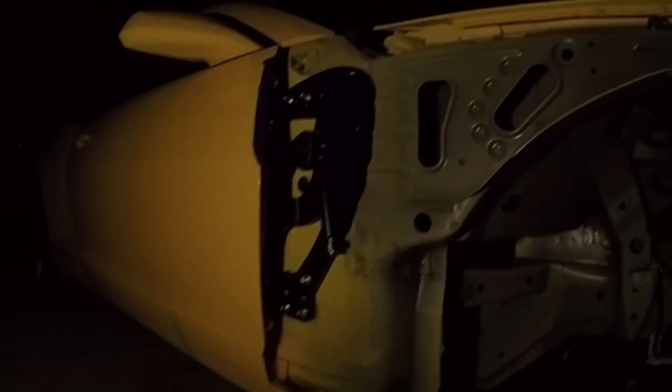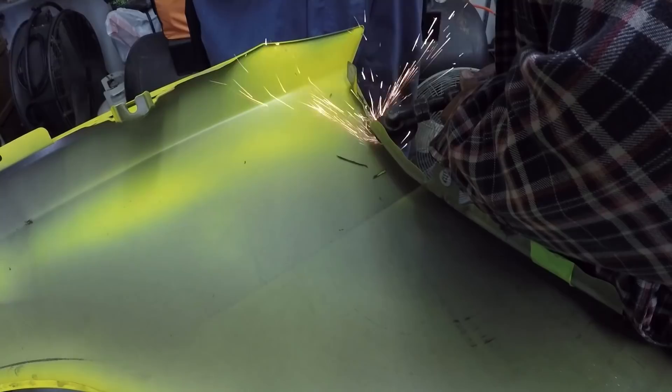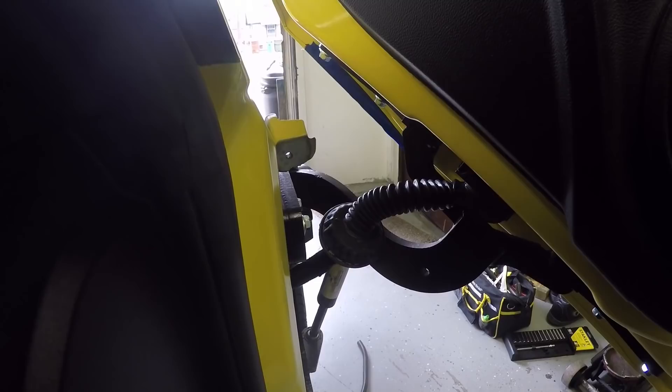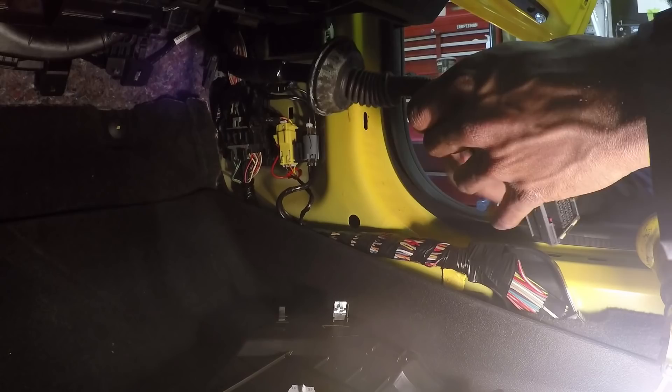The focus tomorrow is really going to be test fitting the fenders and making sure everything clears them correctly. If the doors open and go up with the fenders on, we should be ready to put it fully back together. The next morning we dived right in. In order for the new hinges to clear the fender, a few inches of sheet metal has to be cut on the fender lip — my dad tackled this with a grinder. While he was finishing up the fenders, I worked on extending the wire harness for each door so there was enough slack when the door is all the way up. There was enough extra wire behind the kick panels that all I had to do was cut the rubber boot, slide it back a few inches, and cover the exposed wire with loom, electrical tape, and a couple of zip ties.